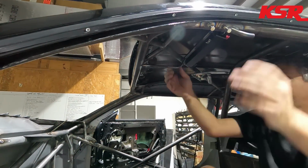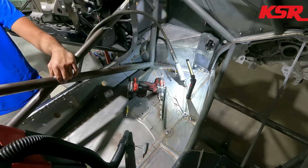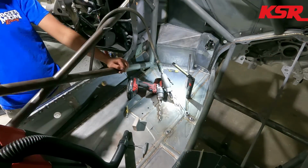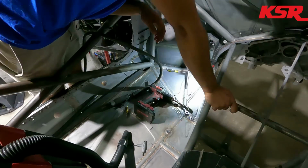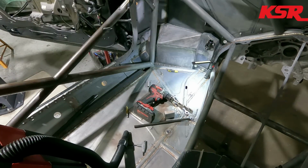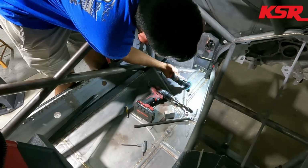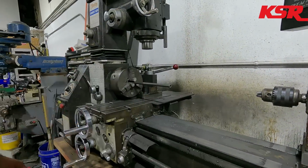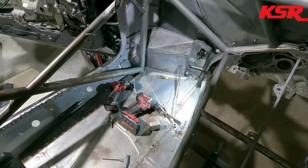The one in the engine compartment is going to be much bigger, since this is a methanol fueled car. It will have a great big system out under the hood. Well, the bottle itself will actually be mounted interior in the car somewhere, but then all the nozzles will deploy out under the hood. These systems are also both equipped with automatic deploy nozzles on them, that if either of the bottles gets hot, well, whichever bottle gets hot, that system will deploy.